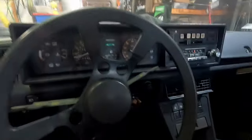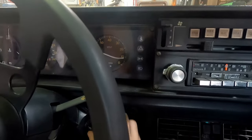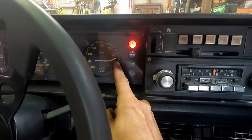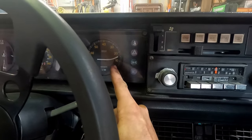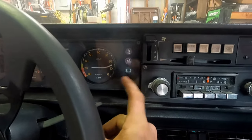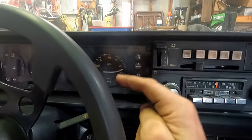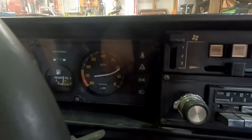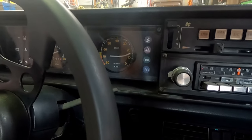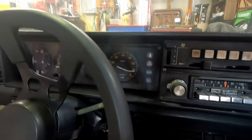But we're going to get in here, and what I was watching was our tach, and now it's kind of hard because of the notorious needle bend. Wow, that fire up is great. But if you follow this straight across, we're basically at 1,000 from what I can tell. What I also want you to notice is how stable that is. That's not wiggling, that's not bouncing all over the place, it's not vibrating. Perfectly smooth, straight across, which is fantastic. And we give a little bit of fuel. Comes right back down to a nice smooth idle, perfectly smooth needle. Super, super nice.